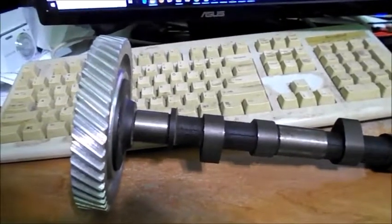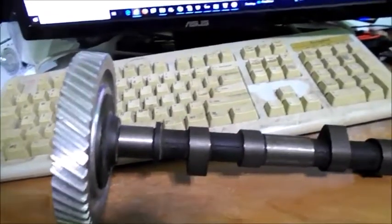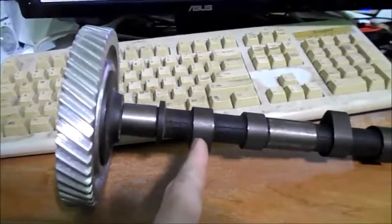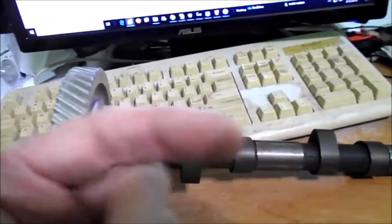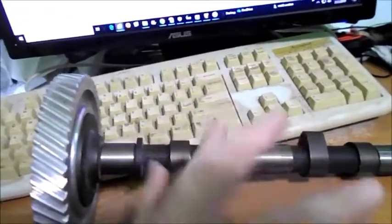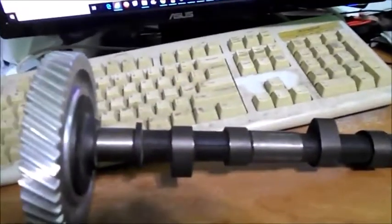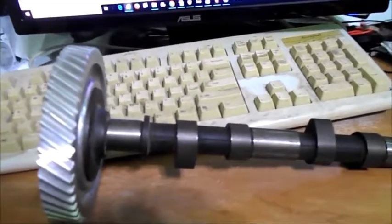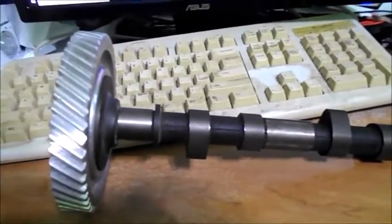Another thing you have to understand about that noise — that vibration noise has to be transmitted through the entire component train. Everything in your entire valve train is feeling that. Your lifters are going to feel it, your push rods are going to feel it, your valve springs are going to feel it. That vibration is going to make its way all the way up to the tip of your valve train. Vibration — not necessarily the spring forces — is what causes your valve float. That vibration at the very top end, when you're getting close to the point where you're going to valve float, the vibration is going to cause your valve float. Your valve springs are probably still good, but your straight cuts and the vibration are going to cause your problems. So that takes care of the cam gears — go helical and go adjustable. That's where you want to be. Thanks for watching.